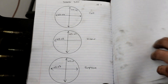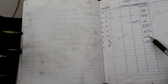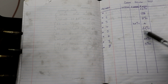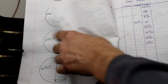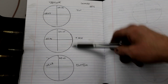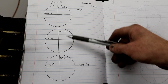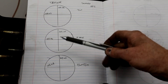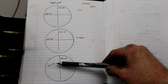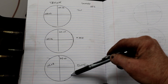Looking at our leak-down measurements — number seven only had 15% leakage, so it was one of the good ones. We've also just done number five, which is our terrible one. Top, middle, bottom — number five shows 103.06 on the thrust side. It's fairly consistent down the middle, but on the bottom of the non-thrust side where we got some scoring we found 103.08. I'm trying to get the bore gauge pointer into the bottom of the valleys of the scores, and I found a deep score around there.